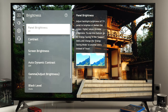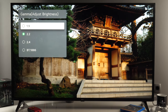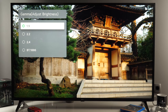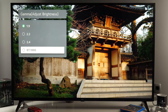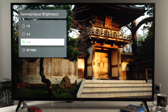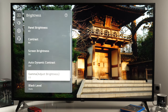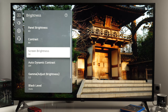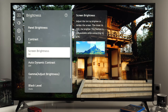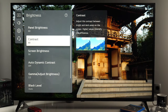If you want to further increase brightness, play with the gamma control — there are different presets here. For a brighter picture go with 1.9; for a dimmer environment you can go with BT.1886 or 2.4; in general I also use a value of 2.2. In this menu you also have contrast, which is white level, and screen brightness, which is black level. There are specific test patterns to adjust these settings correctly and I will put links in the description so you can adjust them on your unit.